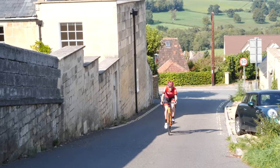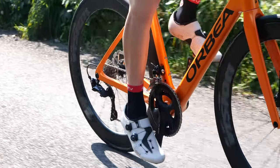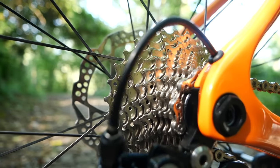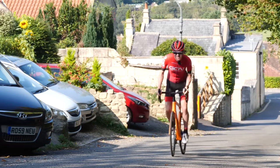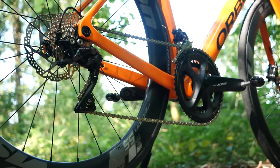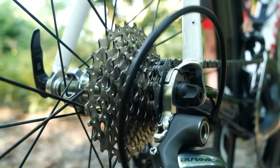This climb is an absolute wall, and I'm already in my easiest gear. But these new 105 group sets are so much more versatile. The cassette at the back can be much bigger. The rear mech has got a much longer cage, meaning you can fit up to a 34 tooth cassette on. You can only get 28 on that Dura-Ace 7900.